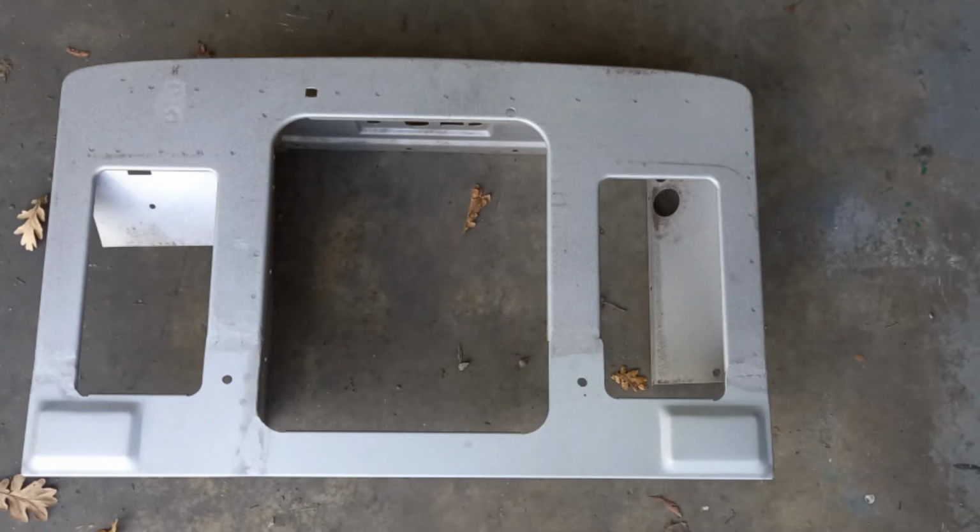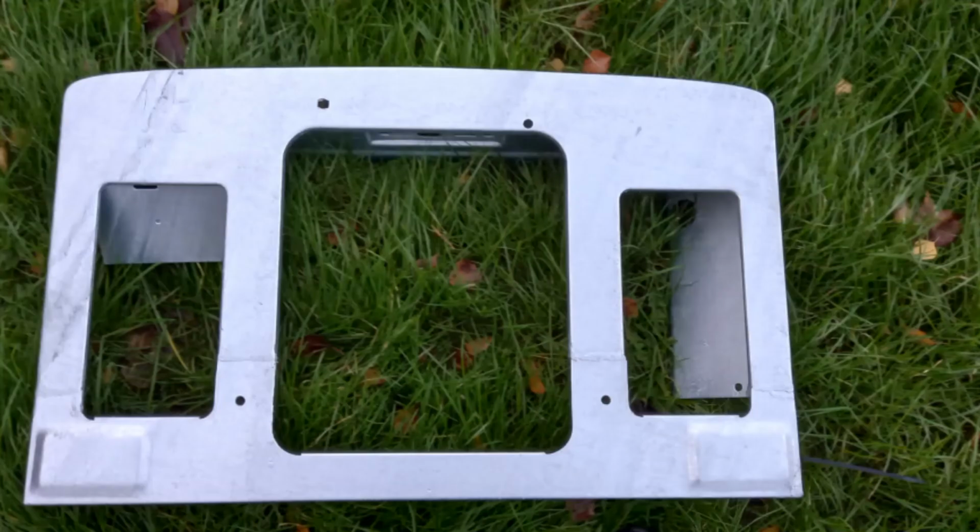This was actually done with chilled iron, and it's incredibly aggressive. This is much more industrial than you would normally use for car bodywork. But because we're having it dipped, it doesn't matter. It actually helps because it's so rough when you feel it. The galvanizing's actually got something to grab a hold of. So in the next clip, we're going to see it all nicely galvanized.